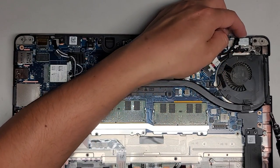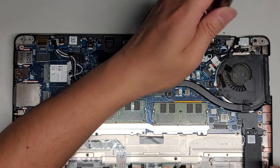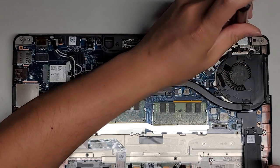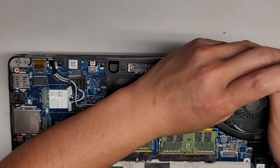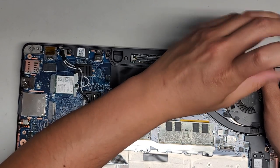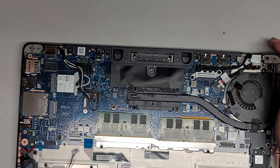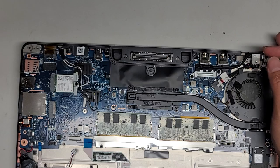This cable is a little bit in the way. It looks like this part broke — I think they dropped this or something because there's a lot of broken pieces here. Let's pull this wire up a little so I can move it out of the way. We're going to take this screw out. One, two, three, four, five, six — so there's the seventh screw. I have a customer here so I'll pause and be back. We've got the seventh screw there holding this charge port or DC jack into place, and then we'll get the eighth screw here.